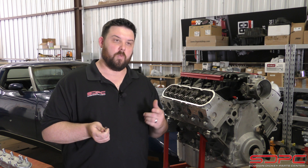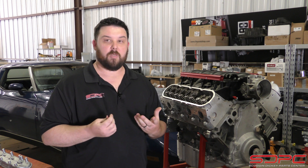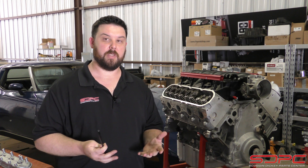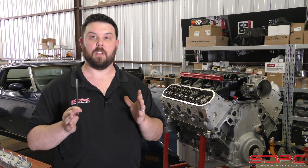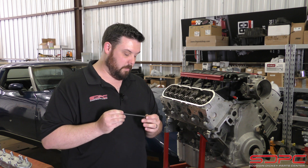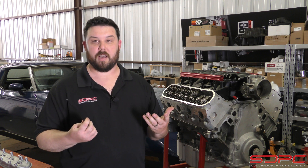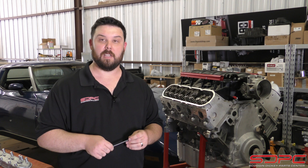Over the years, when camshafts were first being made for the LS1, everything was still stock and most cams had relatively the same lift. The stock pushrod is actually a 7385 in real length measurement, but a lot of them recommended a 7400. Going back to all stock stuff using generically the same kind of cam load profiles, there was a good chance that 7400 would do fine.